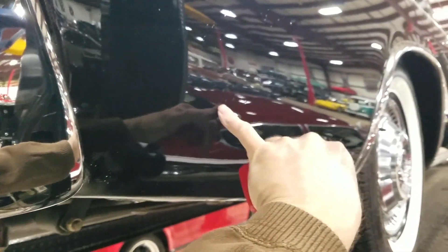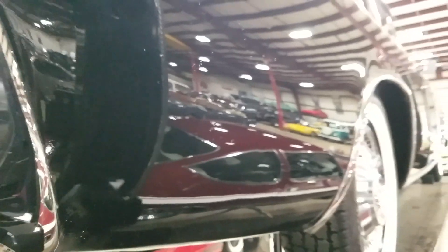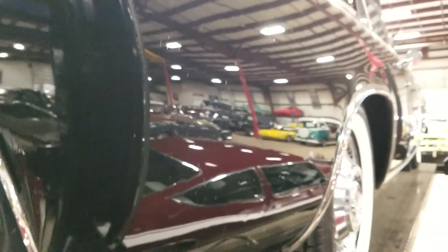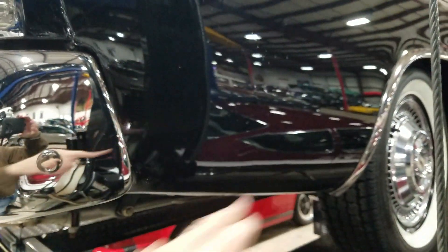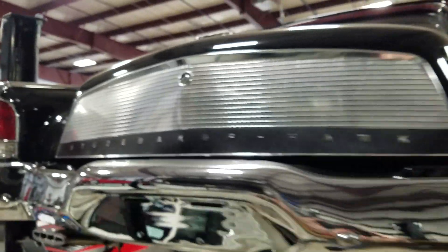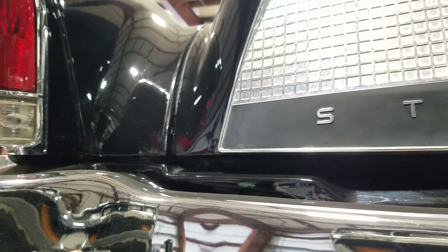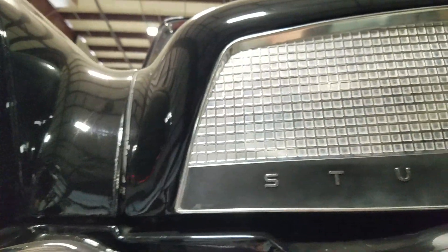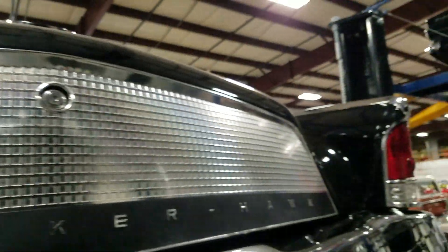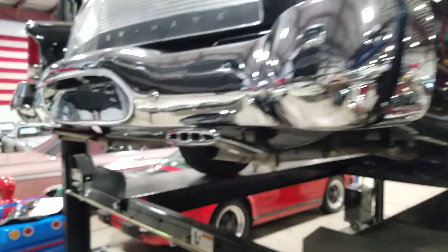Back over on this side, we have a little bit of these solvent pops, or fish eyes, that ventilated through the paint. They look like they've been there a while. Kind of hard to see them, but they're in this little area — a little patch of them mostly right here. The rear end of the body is in nice shape. A little touch up right along the inside of the quarter panel where the deck lid has bedded at one point. That rear aluminum trim shows very nicely.